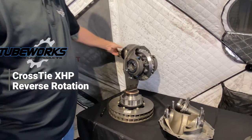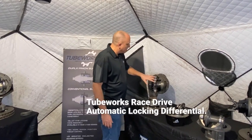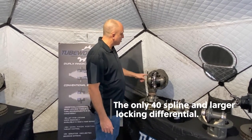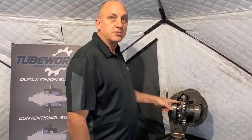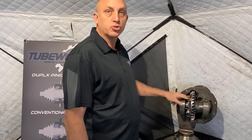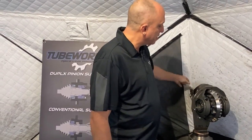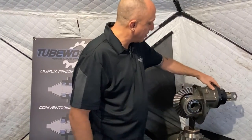The oil system on this works exceptionally. You're going to see these on multiple cars at King of the Hammers this week. We actually have a locker system for this — we manufacture the only 40-spline and larger locking differential. This will take 40, 45-spline, and the jumbo 36 trophy truck axles. It's configured in two different ways: one for bidirectional locking, and it also has internal guts that can be swapped out to a one-way drive system for short course or front application. They're all completely rebuildable, all made from billet components that are heat treated. We feature all ARP hardware — everything on our product, we try to take to the maximum level.